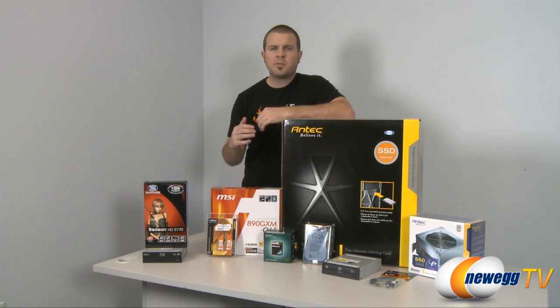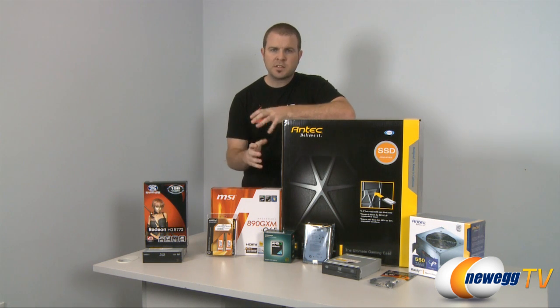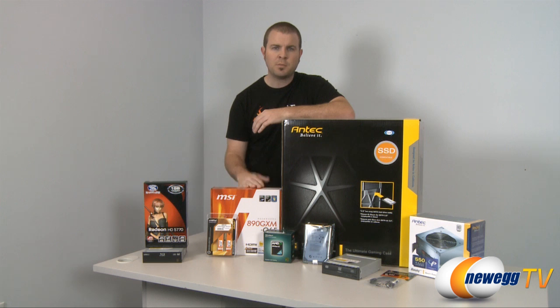Once you've decided which hardware you want to keep from your old build, it's time to start picking out the shiny new hardware for your new build. I'll usually start out with a processor and motherboard, make sure they're compatible with each other, and then I'll choose all my other parts based on that. Remember, the motherboard is a component that ties your entire system together, so keep the specs on hand when you're looking at your other parts to make sure that anything you choose is compatible.